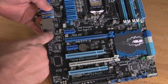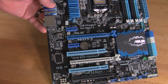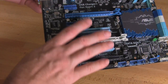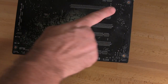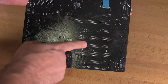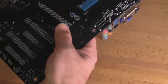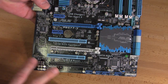Looking at the bottom of the board, you have a couple of 1x slots, your PCI-E Generation 3 slot, two PCI slots, and a couple of PCI Generation 2 slots down here. If you look at the pinouts, with the exception of the top one — which is your PCI-E Generation 3 — the other two are going to be 8x electrical. You can see that by the number of pins in place here; they didn't leave them blank. This board is specifically designed with that in mind.